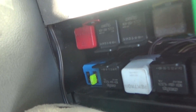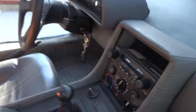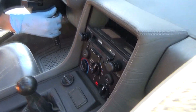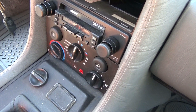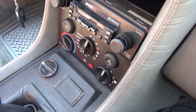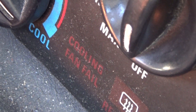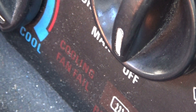Now we are going to test the fan fail light. We've removed one of the fuses from the fan fail relay, and we've got the otterstat jumpered. So we are going to go ahead and start the car up. It's blinking. So the cooling fan fail light is working.